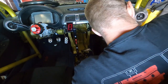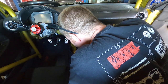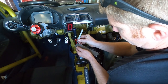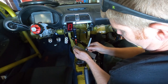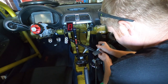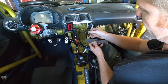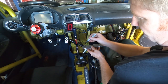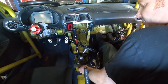So I want them to be even with the driver's side edge. I'll go ahead and mark the centers of the holes. I can take the marker, get lined up with my finger and grip it tight. Then once I get the length the same, I can scribe that all the way down it. Now I have my points at the right depth and the right center to center. Drill holes, and of course I'm gonna make them a little bigger than what those bolts are, and that gives me a little play. So here's our back plate.